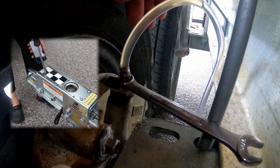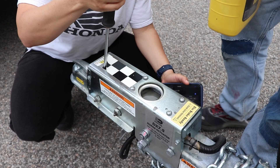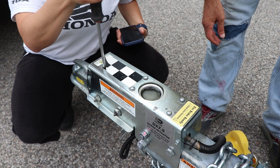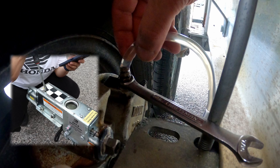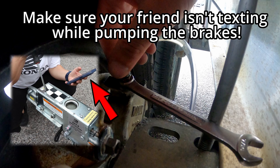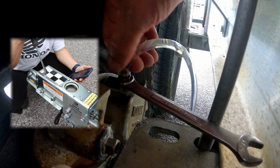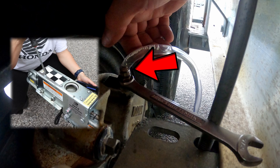After using a wrench to open the valve, I was able to just use my fingers to loosen and tighten it with the hose on it. What you want to do is keep running new fluid through the system to exchange all the old stuff. You'll have to fill the reservoir a few times and make sure all the air is out of the lines. While your partner is pumping the actuator, make sure they are paying attention to the fluid level — if it gets too low it will suck in air, and if that happens you'll have to start the purging process all over again. Make sure your partner is holding the valve tight before you close it to prevent any backflow. Rinse, lather, repeat.